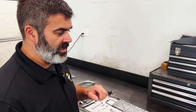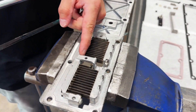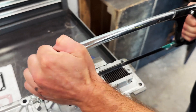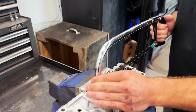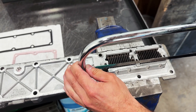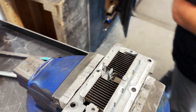We've removed all the components needed, but on this early model we'll have to cut out the little aluminum bridge. We'll accomplish that with a hacksaw, cutting right along the step line as closely as possible, and then again on the opposite side of the intake following that edge. Once we're through, we'll pull that little piece out, then grab an air nozzle and blow off all the shavings.